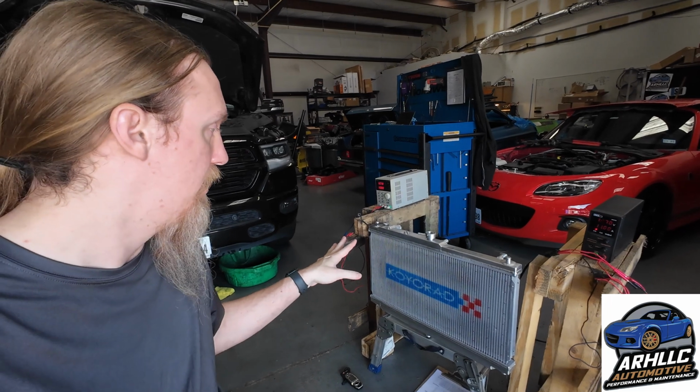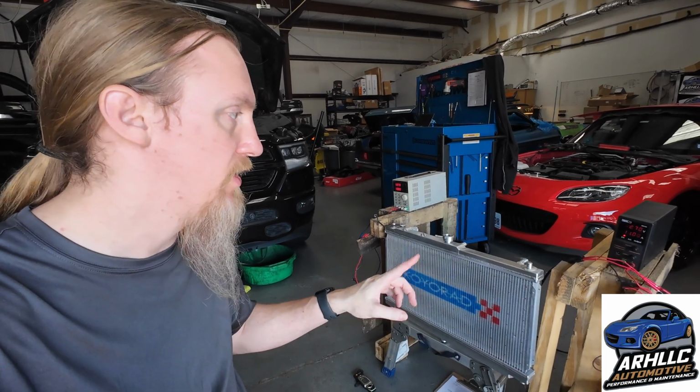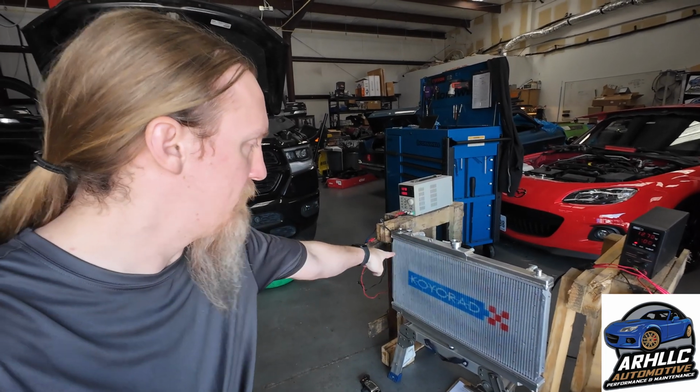However, I went ahead and tested my polarity on my setup to make sure I got the wires all on correct. And I noticed that they're pulling different amounts of amperage by 1 amp, and this one's making a funny humming noise. So I'm willing to bet I'm going to get some lower numbers there. And what we may have to do, in honesty of the experiment, is just take the numbers on one side and then assume that it will be symmetric for the other side.